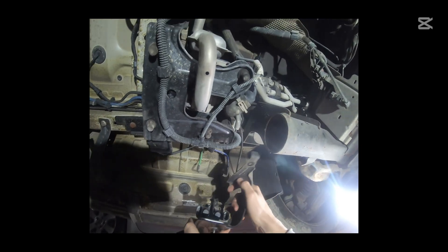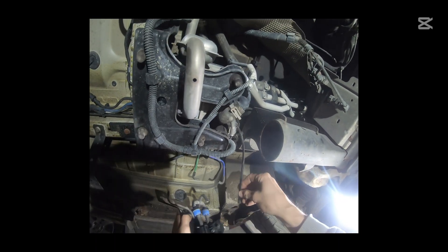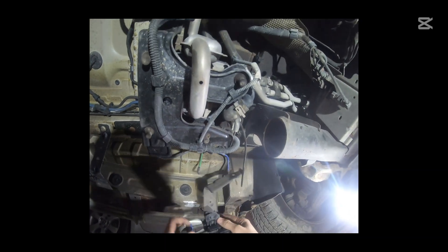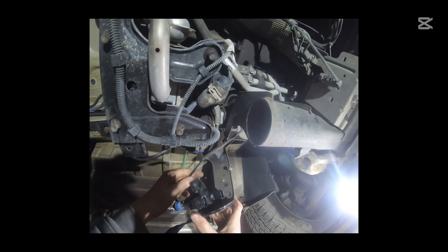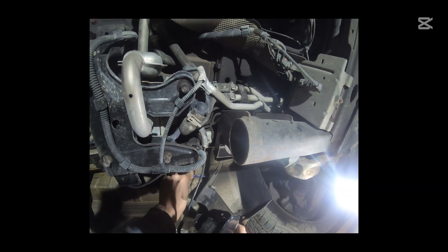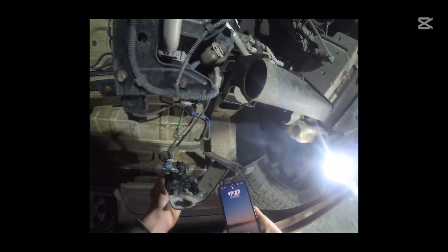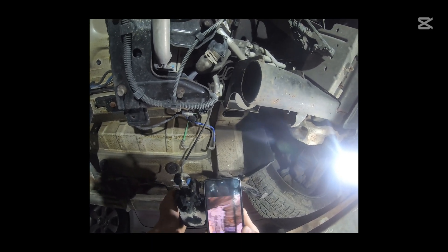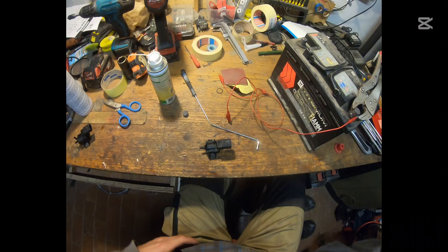As you can see here on the video, I'm showing the position of the solenoid valve block that consists of two identical units placed just behind the left front wheel arch. They are protected by a plastic panel but still quite exposed to the elements outdoors, so they can get damage due to salt corrosion and so on — that is normally also the cause of this issue.